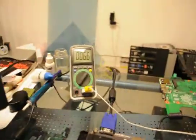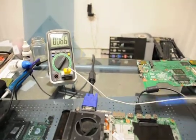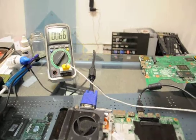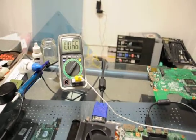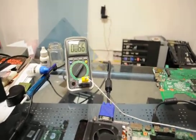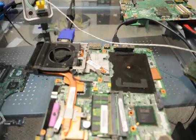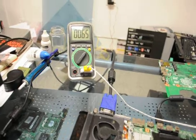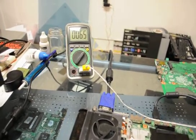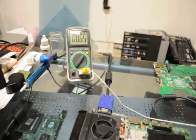Alright, so what we're trying to achieve here with this burn-in test is to rate whether our burn-in has actually heat set the Arctic Silver compound. Now what we have here is we put Matrix on this system, and its signature profile is supposed to, under specific loads, drop the core temperature between 2 to 12 degrees lower on the chipset.